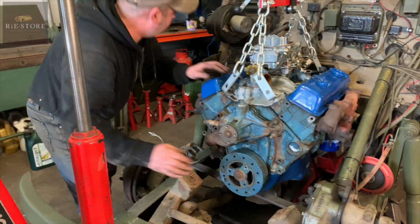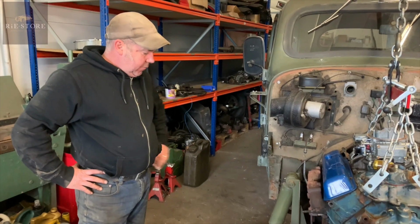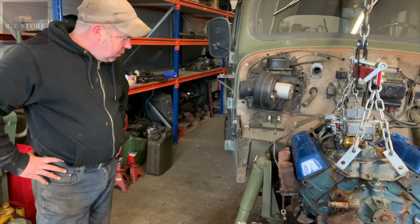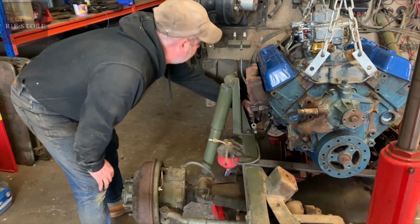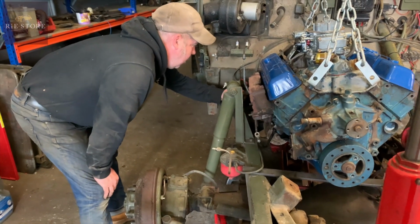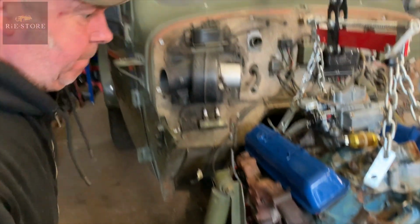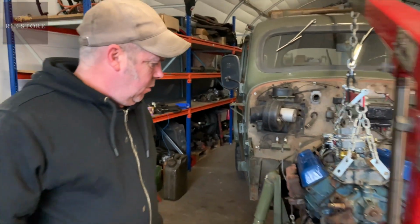All in all, that's a pretty good fit, mate. We'll have to reroute that fuel line, it'll be too close to the exhaust, it'll have to come on the outside here. Starter motor wires reach straight off. Okay, right, now it's a matter of chocking it up somehow.